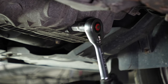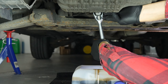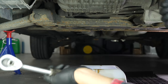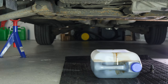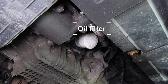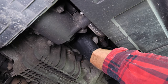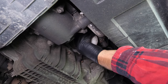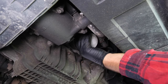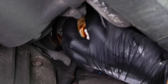When performing an oil change, it is necessary to replace the oil filter. Access to the oil filter is done from underneath the engine compartment. To avoid letting the oil inside the filter from flowing out, place a collector for liquids under it. Loosen the oil filter. If you are unable to do this by hand, you can release it with an oil filter wrench. If the filter remains stuck, watch our video on unscrewing a blocked oil filter. When it has been released, turn it upwards to avoid spilling any oil.